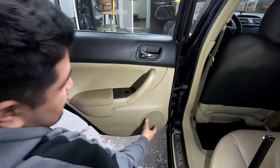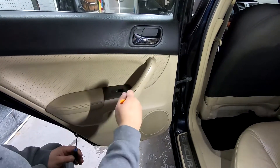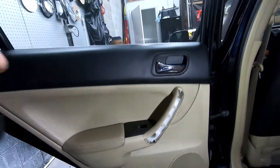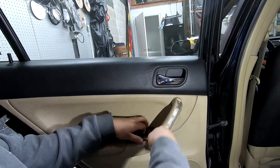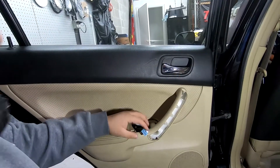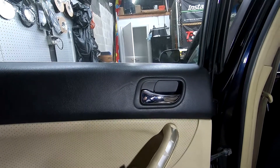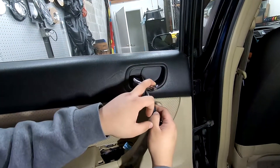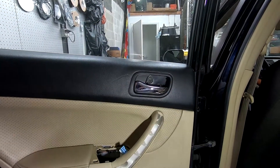To remove the door panel in your TSX to get to the speaker, you're going to need to remove this panel right here — just stick a pry tool and begin popping it up until it comes off. That's going to reveal two screws. Then pop this section up and shimmy in there, which makes removing the connector a whole lot simpler. There's also a little door here hiding two screws — pop that off by coming in at the corner and popping it towards you to reveal two more screws.